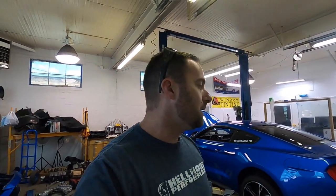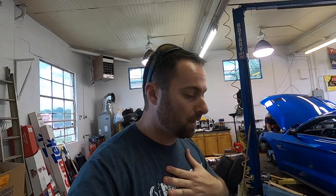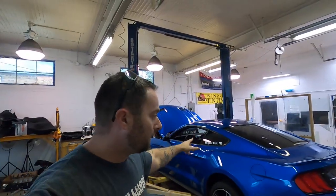So these have modified, like mine, modified OEM stock headers with a T3 flange, not a V-band. But in September, so about 3 or 4 weeks from now, you can't get those anymore. Standard will be a 4-to-1 header. That is right. So Hellhorse is stepping it up, really wants to make a name for himself. I'm glad to be able to help pave the way in that direction. Ken's doing it. Also, determined veteran, good friend of ours, Jack, his GT350R that we have twin turboed, made an easy 1,000 wheel horsepower.